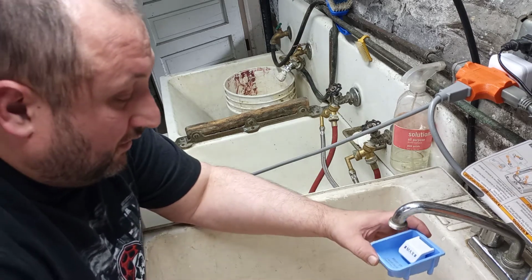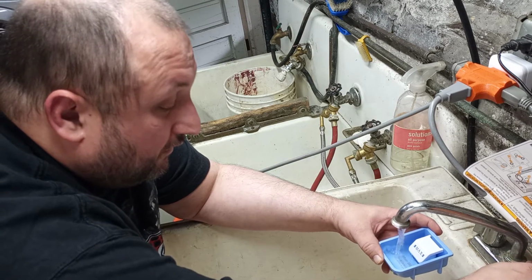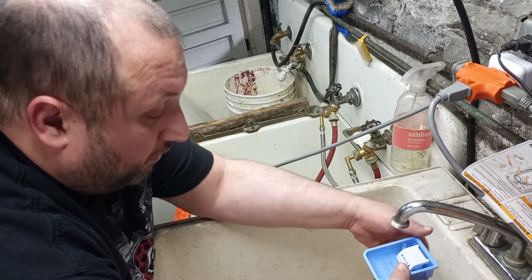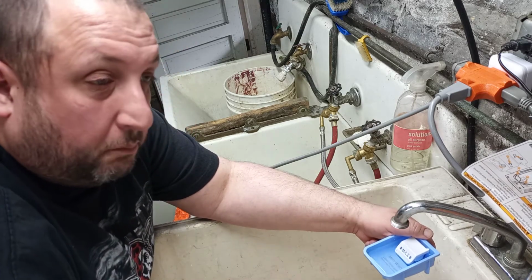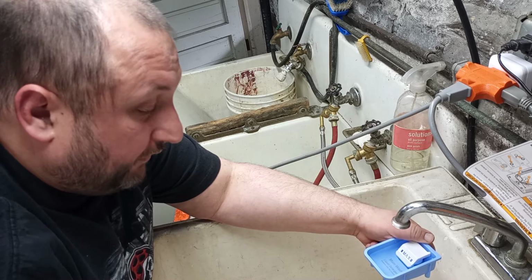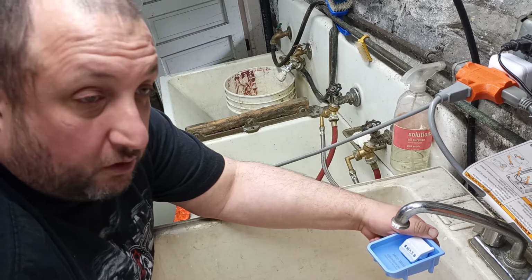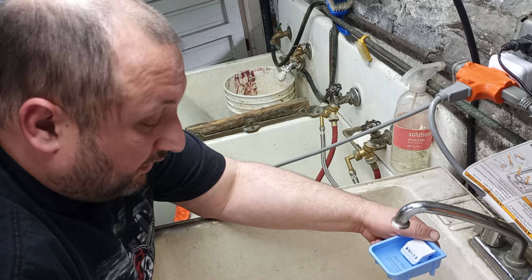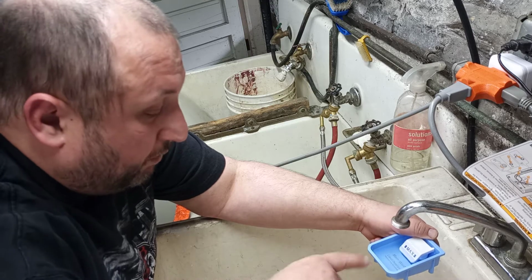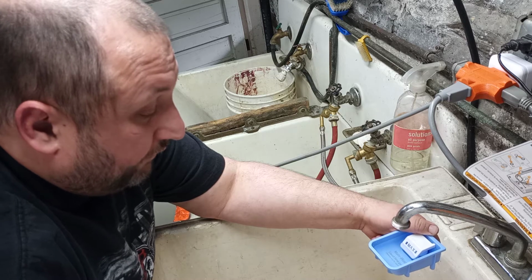So what happens is, when you put the detergent in, naturally you fill it to the max line. Disregard the hole in this, because your bleach and your fabric softener dispenser don't have that hole, but they have a similar tube setup for when the machine calls for those products to be dispensed. I got my whole finger over the hole, so this is basically what you would have while the bleach and the fabric softener are waiting for their time to be dispensed.